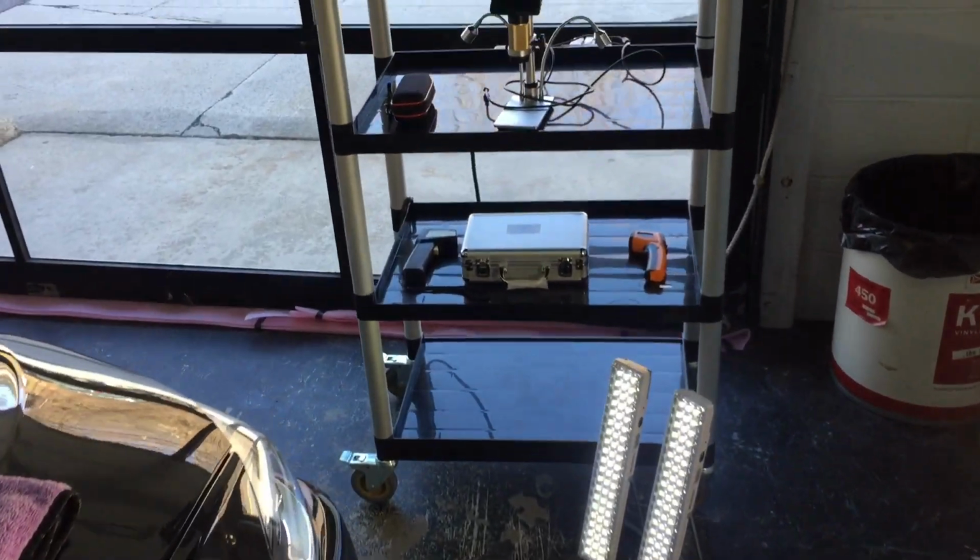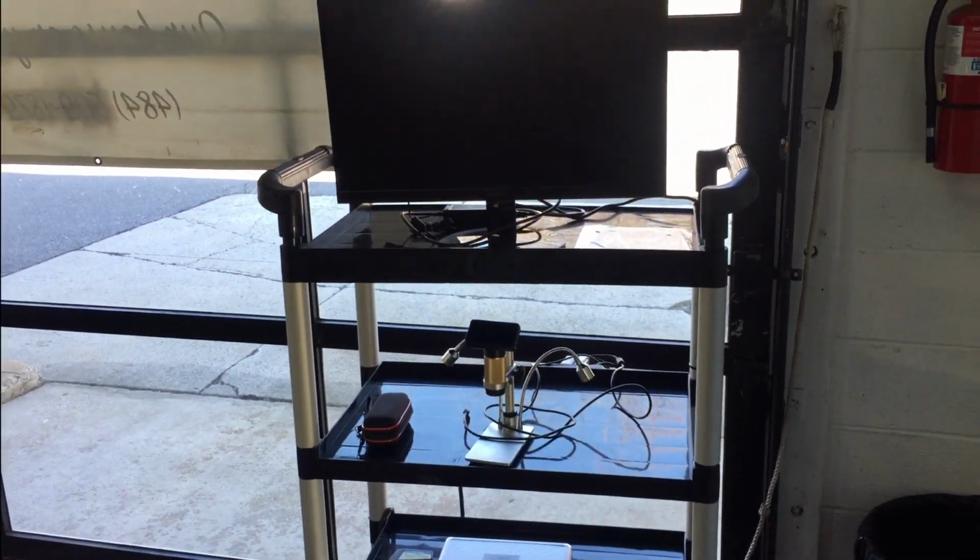I had the ability to get a very close look inside some of these gouges and scratches. And here's one, very wide, very jagged, and it's through the clear coat. I wanted to give you a good look at that. We can also take a look at sections that are down through the clear coat, through the base coat, through the primer, and into the panel itself. And here's a little spot. We're going to come to some more right there. And first, before we do anything, we're going to have to cover that back up to prevent rust.